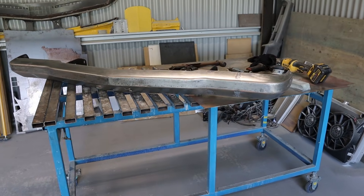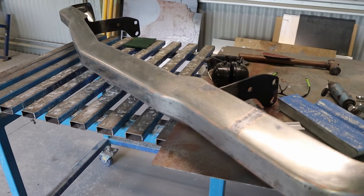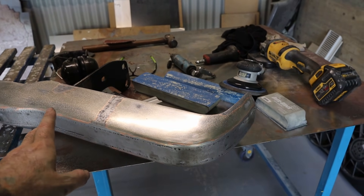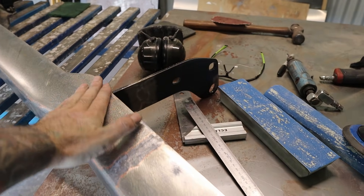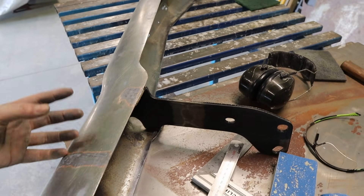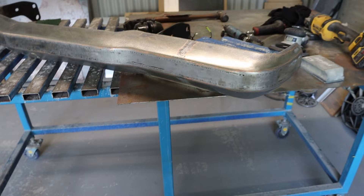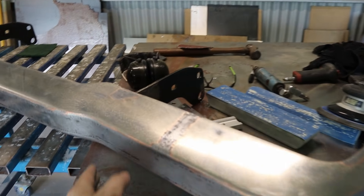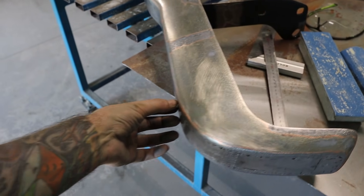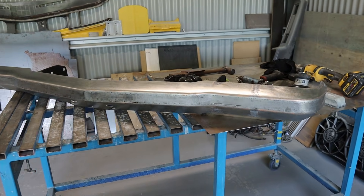To give a bit of an update, I've been working on this bumper and I've done a fair bit of work on it. I've cut and shut it — cut 15mm out of each side. I've got rid of the bolt holes and filled that in, welded the brackets directly to the bumper. I've shortened up the brackets to allow the bumper to sit in 15mm and then also welded these strips in to smooth off the front here. There's like an indent where that rubber sits in and I thought it would look pretty good if I smoothed it off — and I reckon it does.